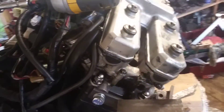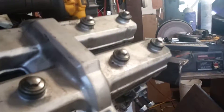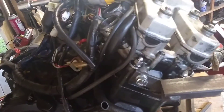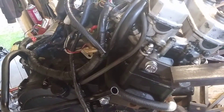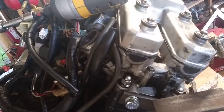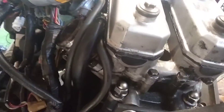Hello everyone. I'm really sorry I haven't videoed in a long time, but I've been working on this motor. I got the thing put back together and I must have done okay, because when I spin it with the battery there's no collision between lifters and pistons. Because on a motor like this there would be interference if the lifters were out of sync with the swing of the piston.